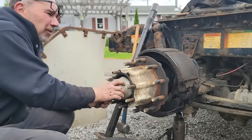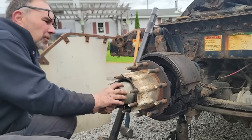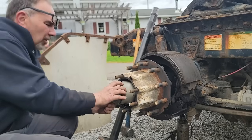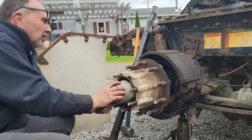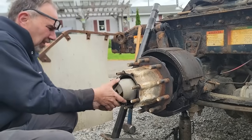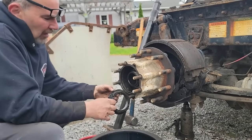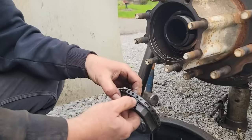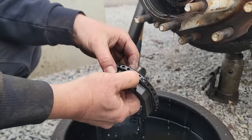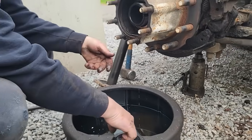I really prefer the old one nut sets the bearing preload. Put your lock washer on. You can set the outside as a jam nut. Use the locking thing to hold it all together. I definitely prefer that. See how that works? These get pushed in with the socket and they allow that to spin. That's all that holds it. Not a big fan.